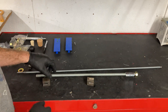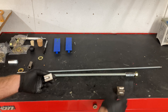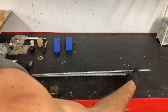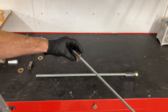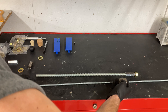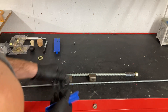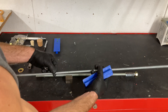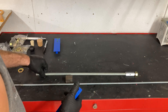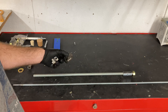That's why you see guys using port-a-powers or really bigger tension systems like Metal Medic, for instance. They have these nice boots that go on here — one just floats and the other side spins, which puts the tension on the panel. Very, very useful for small dents, but if you have anything you really need significant tension on, you've gotta have something that's a little bit beefier.